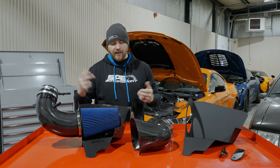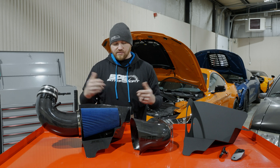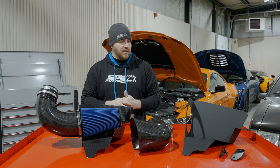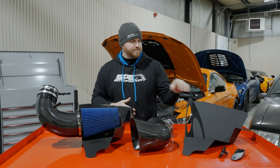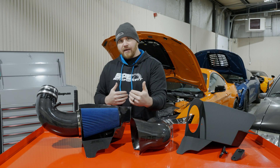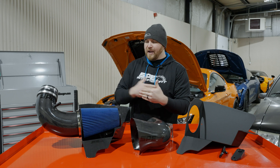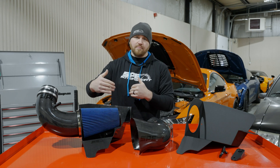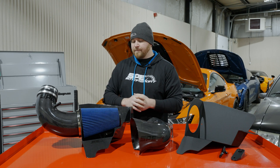What we noticed is that by opening the box up but still shielding as much heat away from it as possible, it ended up helping quite a bit. We also tested gasketing the box to the hood, and ran a lot of different configurations. After all this testing we figured out that by having the box not completely sealed, we were able to bypass static air and pressure build-up and get more volume to the filter, which seemed to be the most helpful for making power.